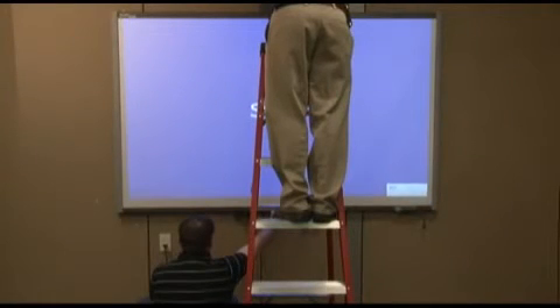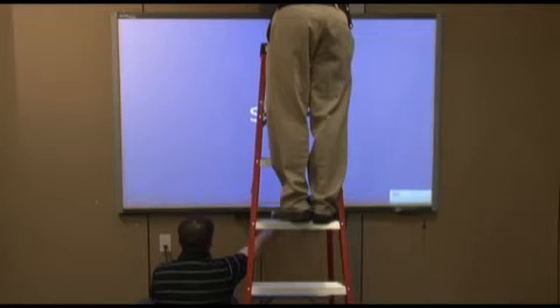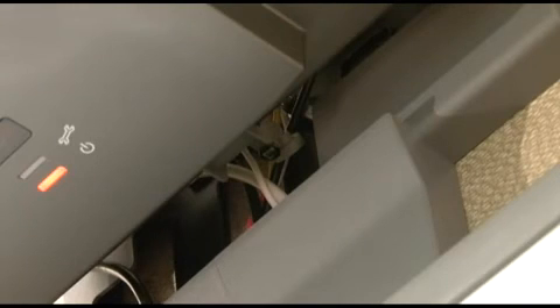When performing the image adjustment process, all adjustment knobs should be smooth and reasonably easy to turn. If this is not the case — if the image jumps or moves suddenly, or if there is a lot of resistance when you try to turn an adjustment knob — stop what you are doing. Then recheck the three adjustment restrictors at the top of the projector and the projector stabilizer bar at the bottom. Confirm that these adjustment restrictors are not engaged and are not restricting adjustment movement, and also check for any other obstructions such as cables which are not routed correctly. Remember that every adjustment knob will impact the others, so after performing coarse adjustments, you will need to repeat many adjustments with finer care.